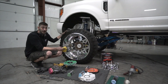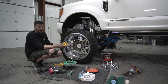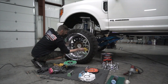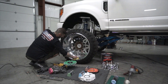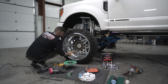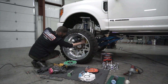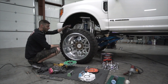Now the first cut's done with the TR2 Triple E compound and the quick cut pad. We're going to take a microfiber rag, fold it over, and soak it with mineral spirits. Wipe down the whole wheel and dissolve all the leftover Triple E that's left on there — all in between the letters. When you switch compounds, you want to prevent cross-contamination. You don't want to mix what the first cut has with the second and on to the finish, so you want to clean off between each pass. Just let that sit for a second, let it dry, and we're on to our secondary cut.